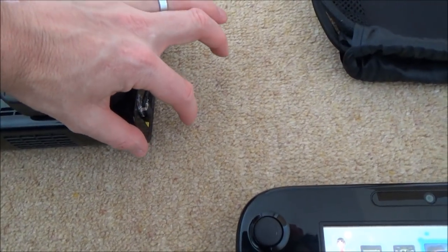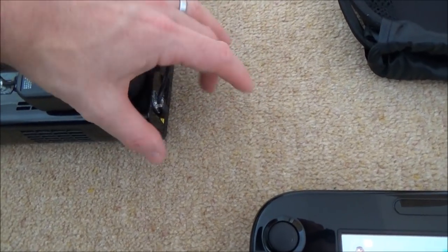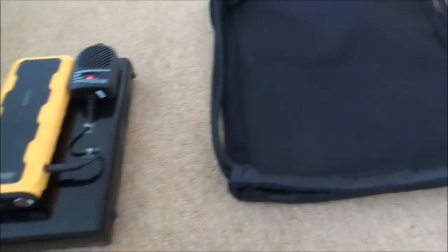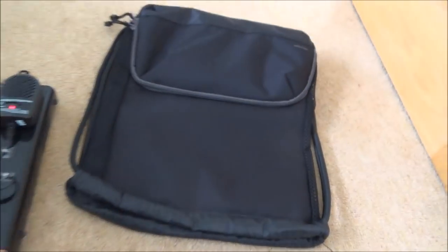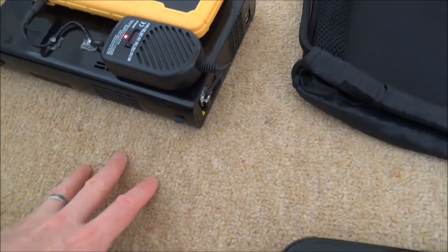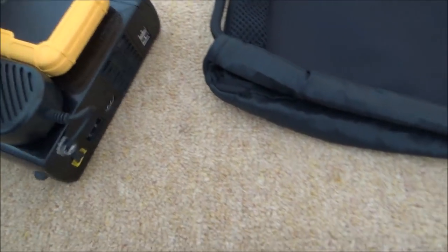What you could do is use a little power adapter, cut the cable that comes with the Wii U, and then splice the step-up converter onto it instead. The idea is that you put this in a rucksack. This is like a gym bag — it's vented with holes down either side. You can also get gym bags and swim bags that have vents everywhere, which will allow the Wii U console to get plenty of air. You need to keep the vents free at the side, the top, and especially the fan at the back.